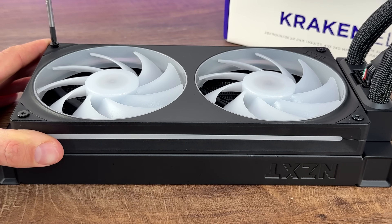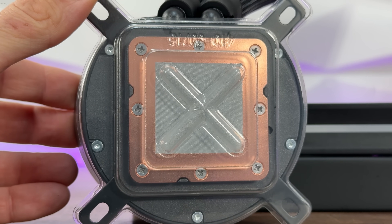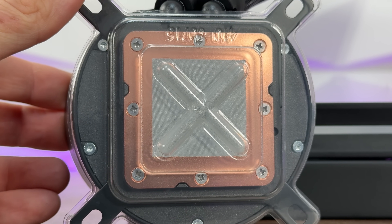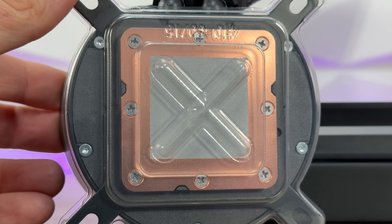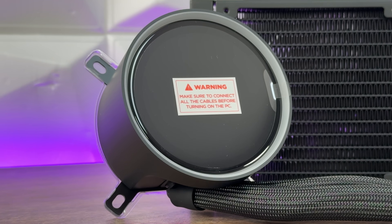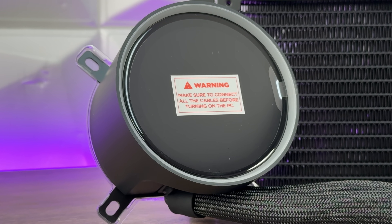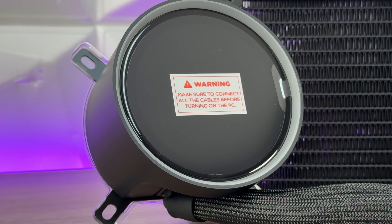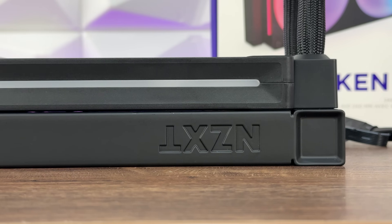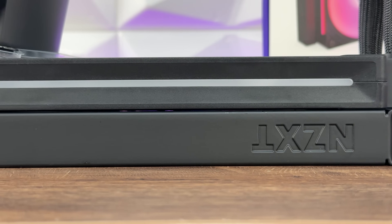They have new cold plates — a split flow cold plate that allows coolant to move easily through the channels, distributing across the CPU surface for quick and efficient heat dissipation. On specs: the NZXT turbine pump in collaboration with CoolIT runs at 1200 to 2800 RPM, plus or minus 300.